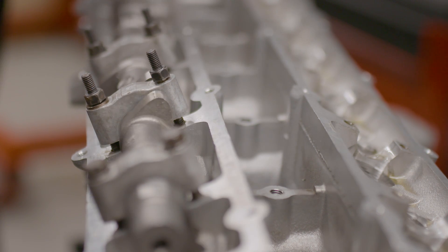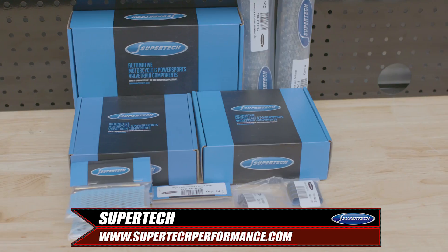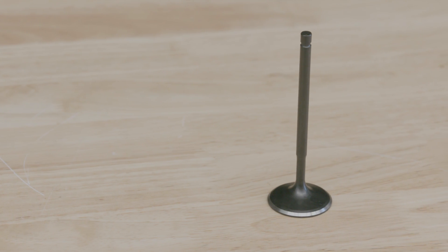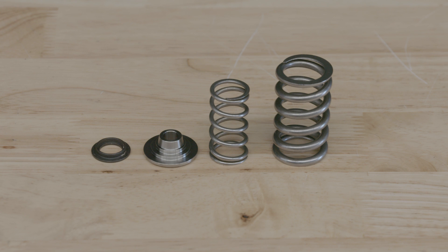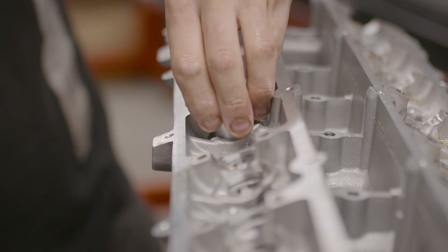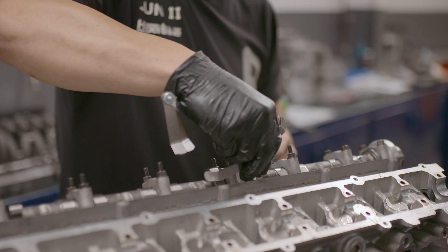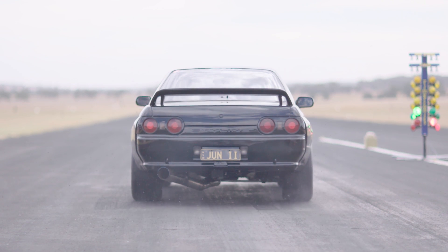We went for a 280 degree camshaft as we don't want to rev past 9000 with the factory crank and we're still a 2.6. We then opened up the Supertech catalogue to fill the head, thanks to the guys from Faber Australia. 1mm oversize valves for extra flow, double valve springs chosen as they have stronger pressure but won't bind with high lift camshafts, Supertech retainers and Supertech buckets which have a different design inside than factory to help hold in the shim. You may ask why we didn't go shimless — that's because you can't adjust the clearances as the engine wears or if you upgrade camshafts in the future. War GTR and Jun2 still use shims, so if it's good enough for them, it's good enough for us.